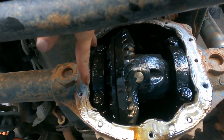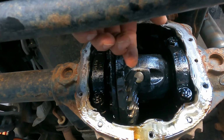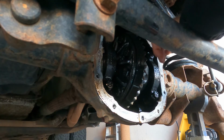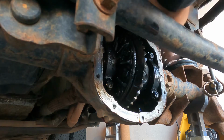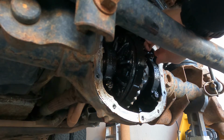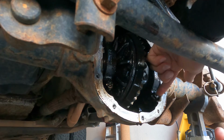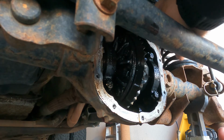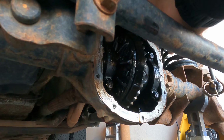Take these two bolts out and these two bolts out. Bearing caps. I'm pulling this out, actually pulling it out and down, and then we'll start working on this piece. Okay, so one thing to mention as I'm getting ready to take these off, these bearing caps are set to each side of this. You don't want to switch them. And I even go so far as to use the same bolt in the same hole. So when you pull these off, you want to make sure you know this bearing cap is the right side, you know which part's the top, you know which part's the bottom, because this thing is milled to fit exactly as it should. Have people swapped them? I'm certain they have. I don't.